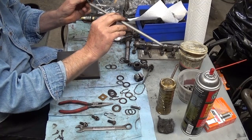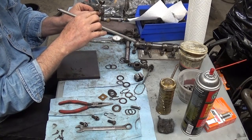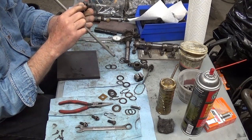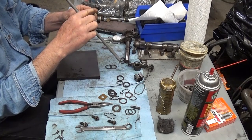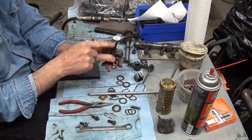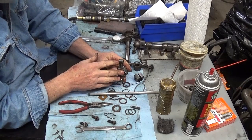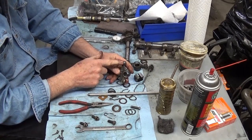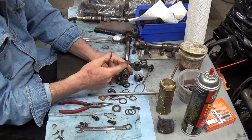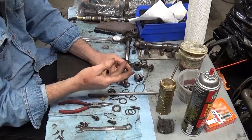So that surge is causing some extra oil to go in there, and it lubricates this inner bearing. It also travels to the other side and goes up. It doesn't come out like over here. It goes behind the thread. And so your adjusting screw, I hope I'm in the camera on that. I probably wasn't. I have to do a video 15 times, seems like. But the oil splashes out the thread, and that's what gets on top of the end of your valve and keeps that lubricated and wet and helps remove some of the heat that's going on right there.